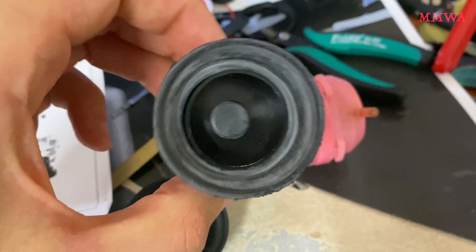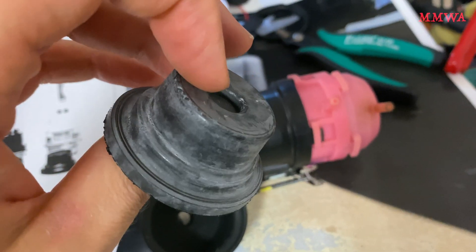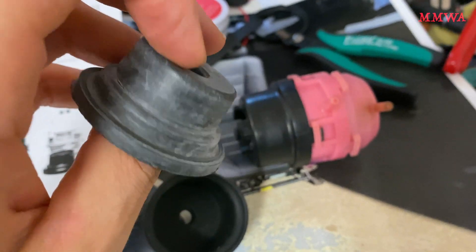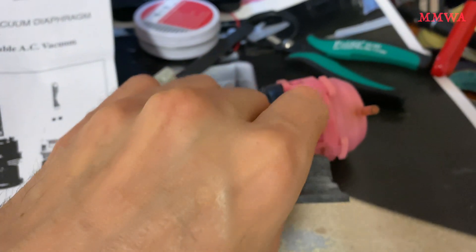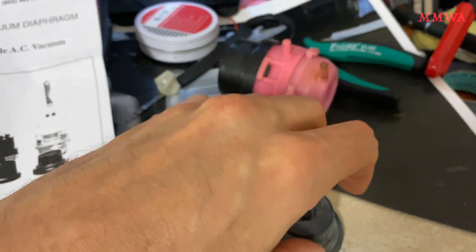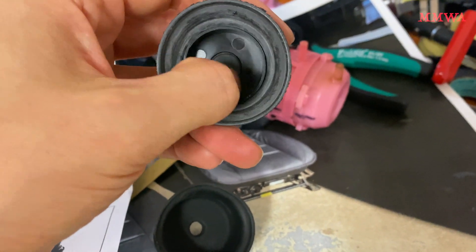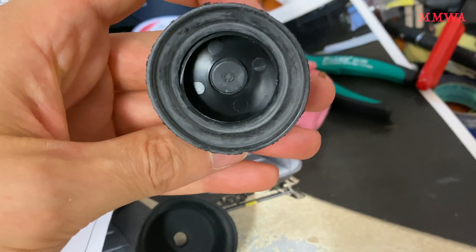One of the diaphragms can't be removed without breaking the internal assembly, so you actually slice it off and this thing is pressed in. It's the rear one I'm talking about, underneath this cap here, and they've got a plastic shield in here which prevents the big spring from cutting up that diaphragm in future.